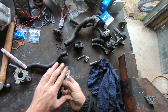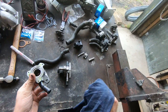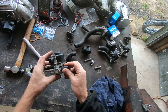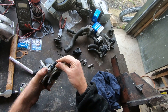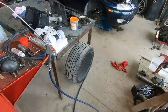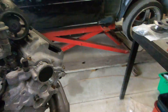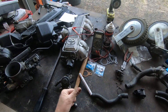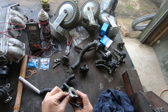They have water hoses going through them, and on my throttle body mod I removed the water hoses running through the throttle body, and at the same time I remove it through the stepper motor like this. On the non-EGR versions there's this little blanking grommet, and that works perfectly for blocking off the water fitting on the back of the engine. So when I remove the water lines I just crimp them in the vise, give them a wiggle, pry bar in behind and they pop out - they just press in. Then I've got the die grinder in and cleaned it up a bit.